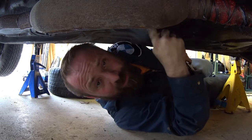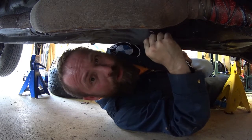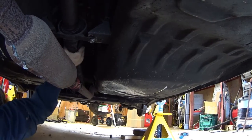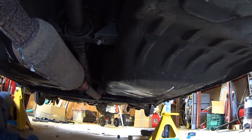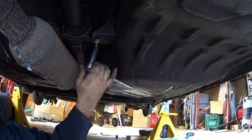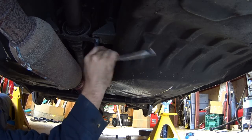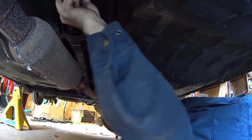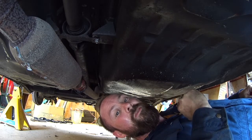The reason I wanted to take the drive shaft out is the last time I was driving it gave a really awful vibration around 30 kilometers an hour. I thought one of the U-joints had gone, but when I started taking it out it looks like the midship bearing is really loose and probably ruined. I'm going to tighten that up and order a new midship — hopefully the problem goes away, because the drive shafts are not serviceable and very expensive. Tightening it up — yeah, that's way better already, though it still probably needs a new midship.